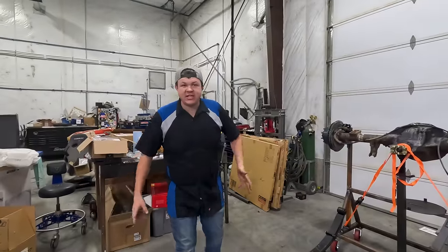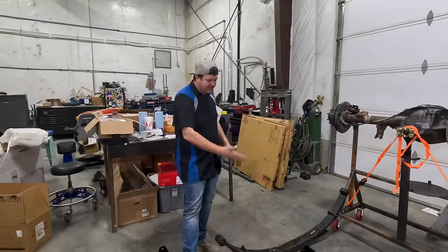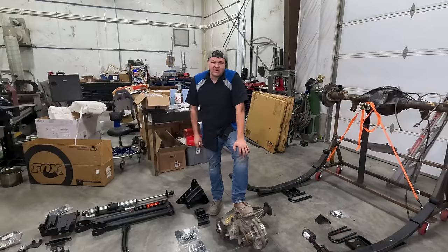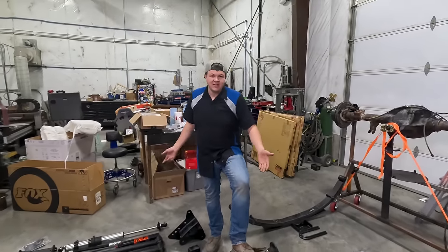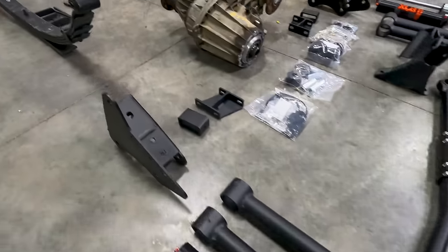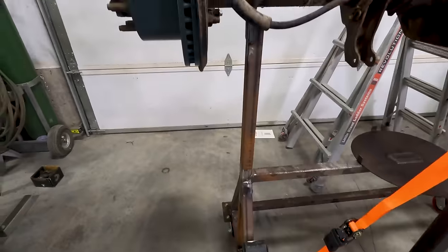This is all the suspension we're putting in the bus. We've got a rear axle, leaf springs, U-bolts, a 271 transfer case that's going to bolt right up to that 4R100 transmission. The cool thing about the bus is it has a four-wheel drive transmission — it's required to have a 4R100 four-wheel drive transmission to put an e-brake assembly on these buses. We've also got Fox coilovers and all our BDS suspension trailing arms, towers, bags of bolts, and a Dana 60 that we built. We've got to get the bus up and get the two-wheel drive front suspension ripped out and figure out how to fit all this in.